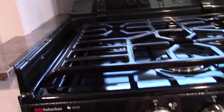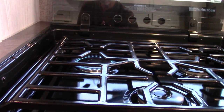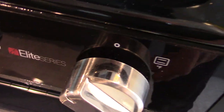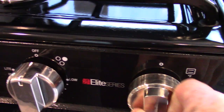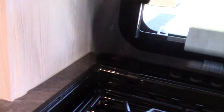To light the burners, you go to light and then you spark it — that's all you do. You've got three burners and three knobs. The oven is a little different. There's a pilot light at the very back at the bottom. You come to the oven knob, go to pilot, depress and hold it, and continue holding while you spark it until the pilot light lights. Once the pilot light is lit, you're still holding the knob in for another 10 seconds to heat it up, then go to operating temperature. It cycles on and off like an oven does. When you shut it off, the pilot light goes out too, so you have to relight the pilot light each time you start the oven.